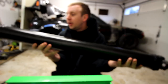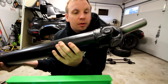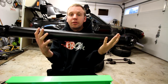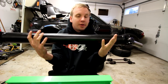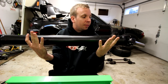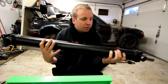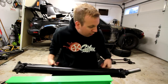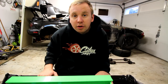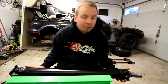It is very nicely made, all solid one piece, just like the OEM one, and all welded up. I don't know if you can tell, but it looks like nice MIG welds. And Advanced Driveline made this for me in 3 days. I gave them my measurements and told them the flanges I needed and what it was going to, and they made this in 3 days, and it was $300. I knew I needed a custom drive shaft made for the swap, and I'm glad I went with them instead of Driveshaft Shop. The only reason I did not go with Driveshaft Shop is because of shipping, and this was right down the street from my work.